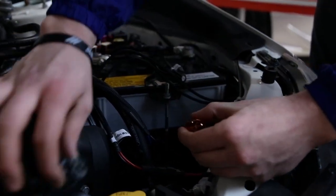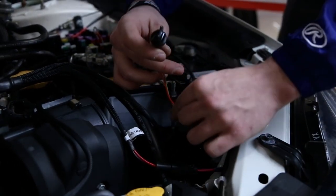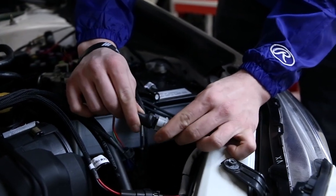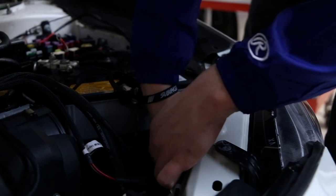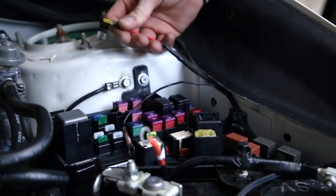As well as the turn signal harness. Once you get to the turn signals, you're going to remove the bulb from the OEM socket and put it into our jumper harness. You're going to connect the black piece of our jumper harness into the OEM socket and put the bulb back into the headlight.